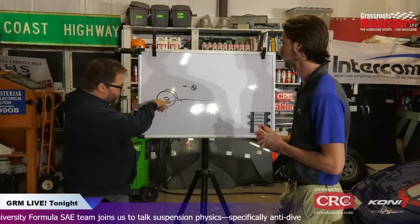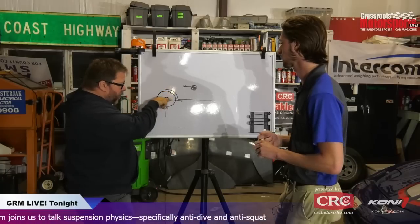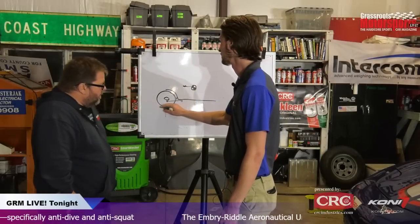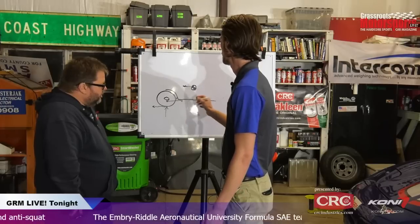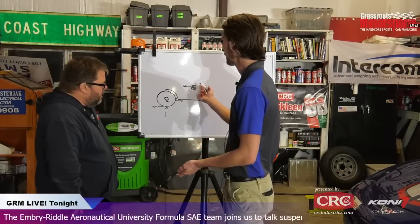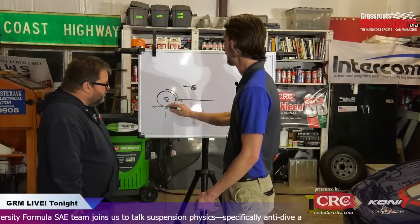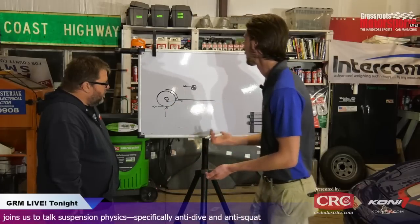So you have essentially a thrust vector from this rear axle going forward. Essentially it's the tires rotating, and it's giving you a little traction there, right? And so that same reaction, now the center of gravity is experiencing that, and that creates a moment about that rear tire, which is reacted there by the force of the tire itself.